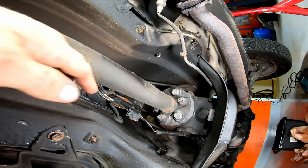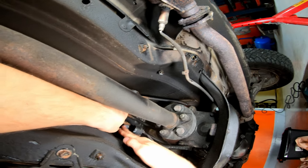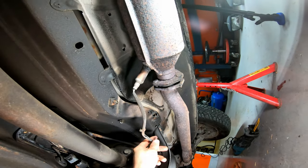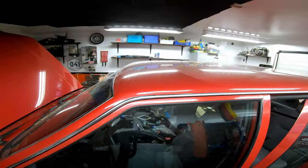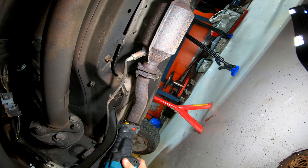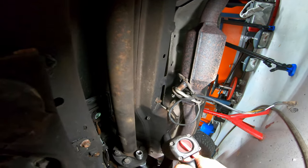There's one more thing that we need to take care of under here by the gearbox, and that is the reverse light. It can be quite stubborn, but this one came out quite nicely actually. Next thing is the exhaust — maybe some eye protection and so on. These are both 19 millimeters, by the way — could be good to know before you dive under here.